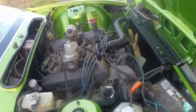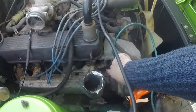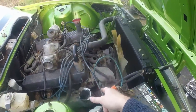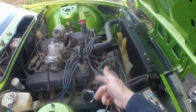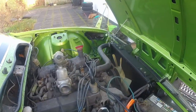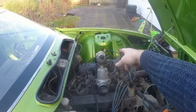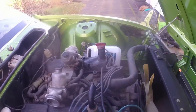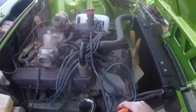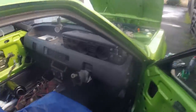I want to check that the oil pressure warning light is working. On the Series 1 cars, the oil pressure switch actually controls the fuel pump — the pump won't deliver fuel until it gets oil pressure. I've left the fuel line off at the moment and I'm going to direct it with a bit of hose into a bucket so it doesn't shoot fuel everywhere. That'll be my key indicator to know whether I've got oil pressure and whether the fuel pump is switching on. I still get butterflies whenever I do this sort of thing.